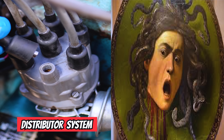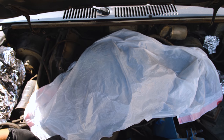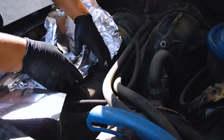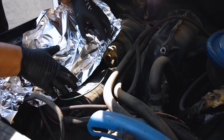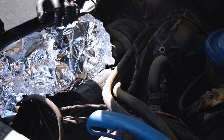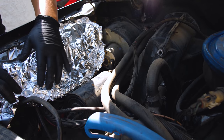The wires are Medusa's hair and the distributor is Medusa's head, while the alternator can be compared to a plastic strainer. Once you identify these parts on your engine, wrap them with foil paper or plastic bags. And if you happen to see any other wires like this, wrap them as well. The majority of engine parts are water resistant — they can get a bit wet, but we have to avoid getting these parts soaked. If water stores in any of these places it's going to cause problems. That's why we isolate these parts and use the least amount of water possible. Once you protect these parts, we're ready to start.